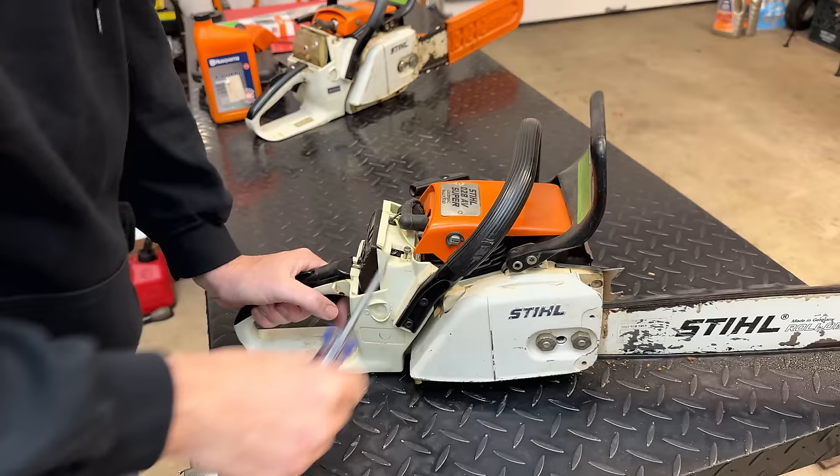So that's kind of telling me that we might have issues with seals on the engine block or on the crankshaft. But it could be something as simple as the carb, and that's an easy thing to swap out. And Stanley did include a clone one. So I say we start there. Let's do the easy thing. We'll put this on, we'll start it up again and see if it runs any better.